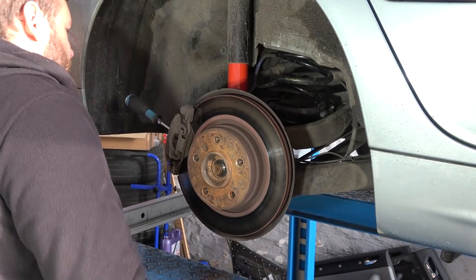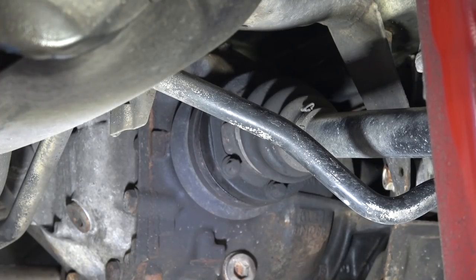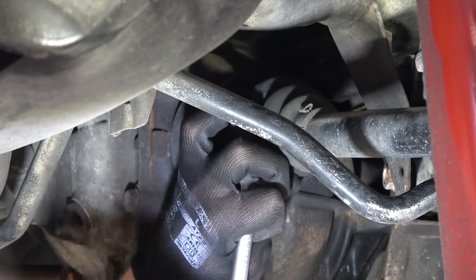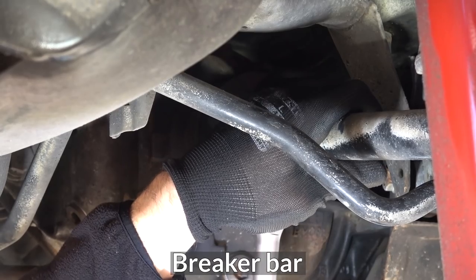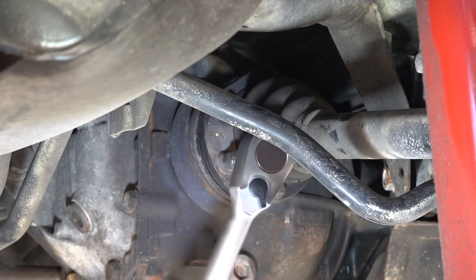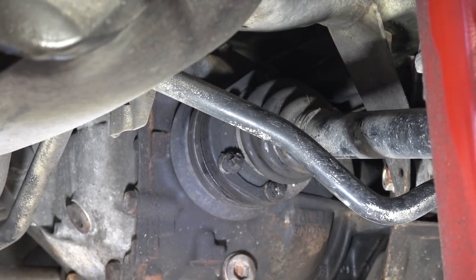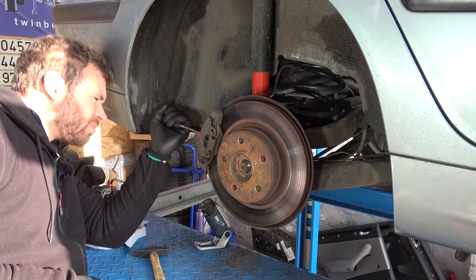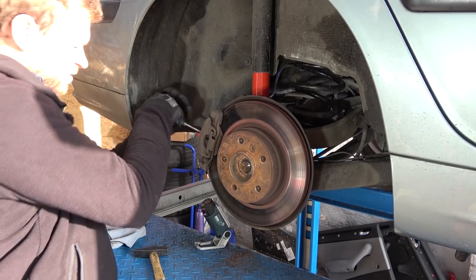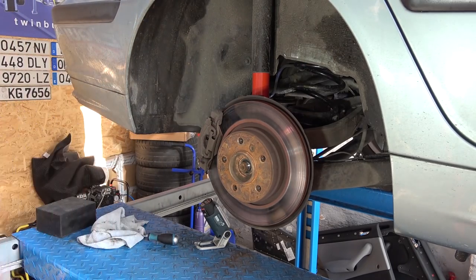I think next we can remove the axle bolts on the differential. Inverted Torx. E, was it 12? Why, yes. That's much easier. All right, we'll remove them completely later. Give me back my screwdriver. Now compress the piston a little bit, like that. Remove the wire clip.